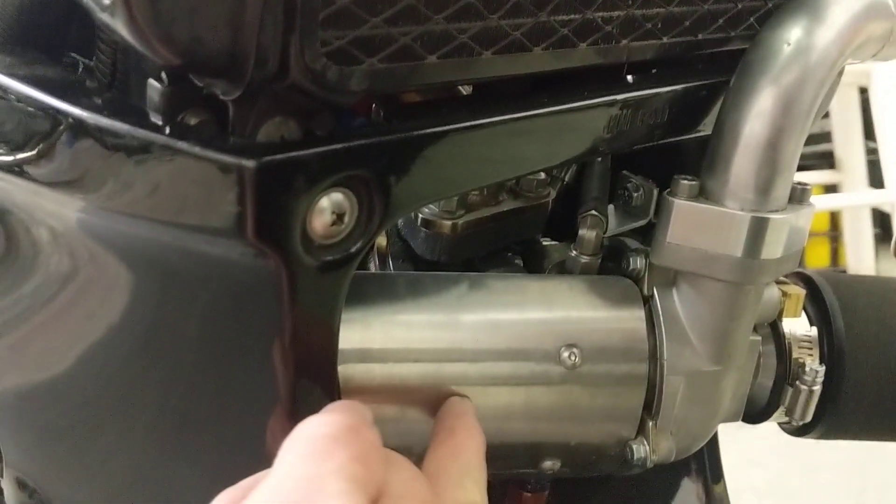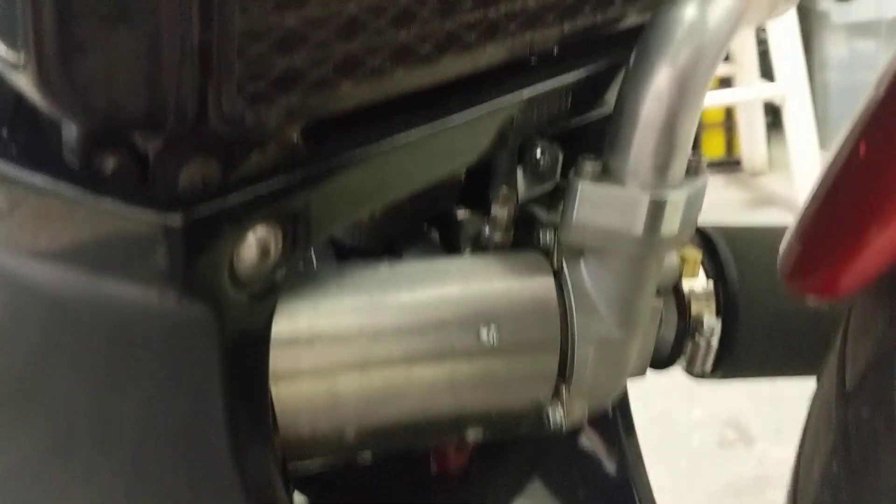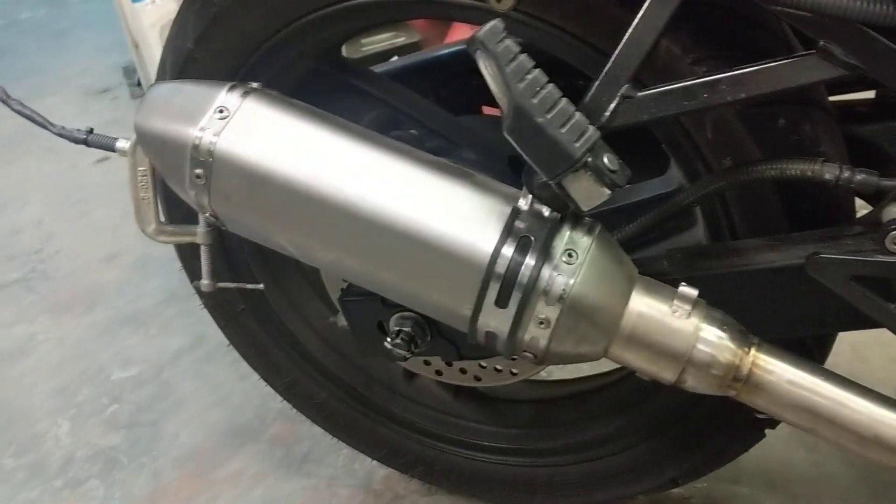There's a stainless shield on the front of the turbo to keep the hot side hot — stop trying to cool that which you lose efficiency. And then one and a half inch turbo downpipe out into a single muffler.